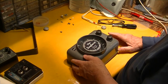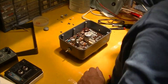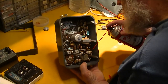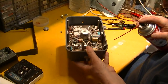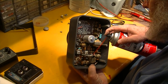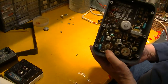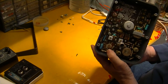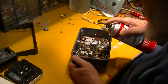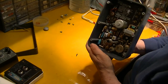While I'm in here I'm going to spray this sensitivity pot with a little cleaner. It looks like a pretty hard pot to get into, but I could see when I was turning it before there was a little noise on the neon bulb flash, which meant the pot was dirty. So we'll do that and spray this switch just a little bit to get any grunge off it.